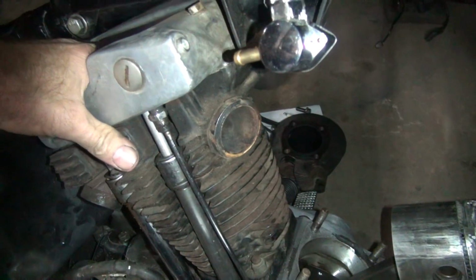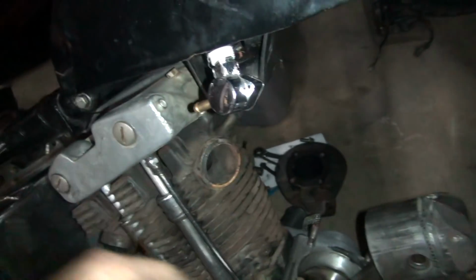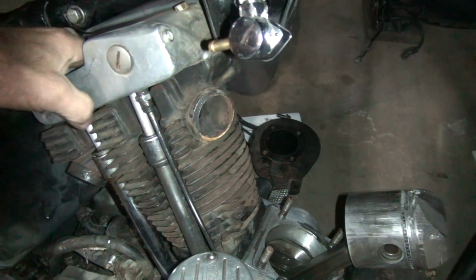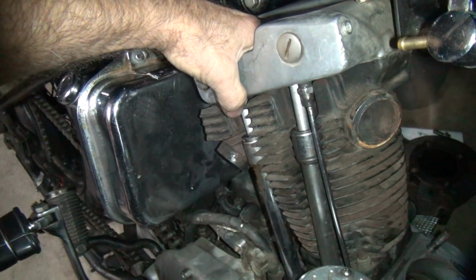Not circulating oil in that cylinder. Air went from here through that hole into there and came out over here. It blew right by that. The rings are supposed to stop blow-by. That's what they call blow-by. So that's why those oil things blow off. You got too much cylinder pressure. Too much crankcase pressure, not cylinder pressure.